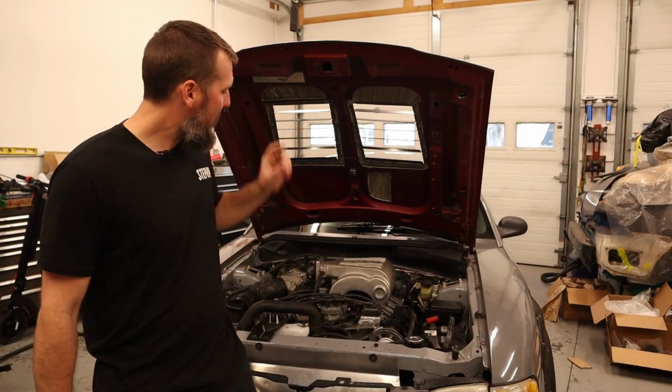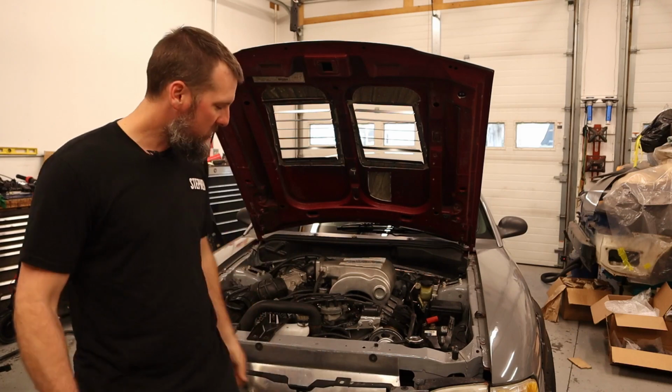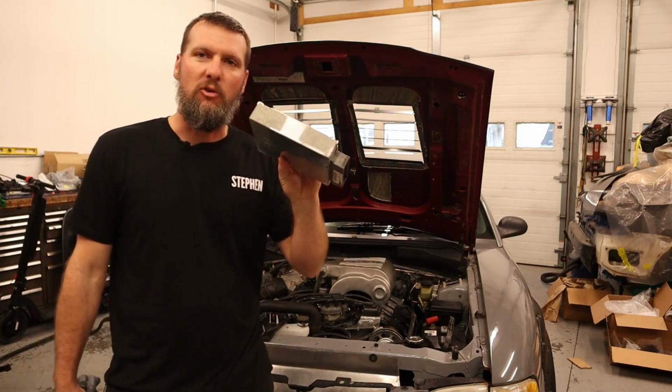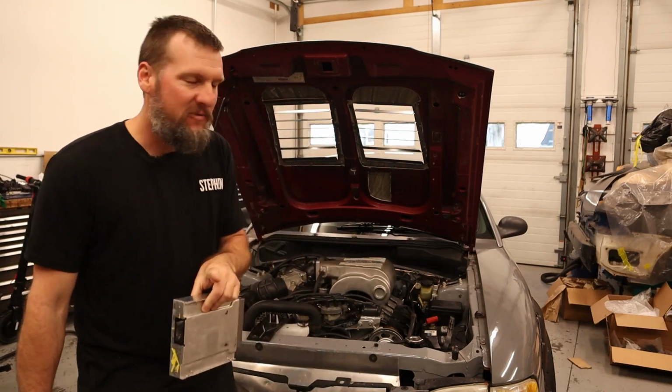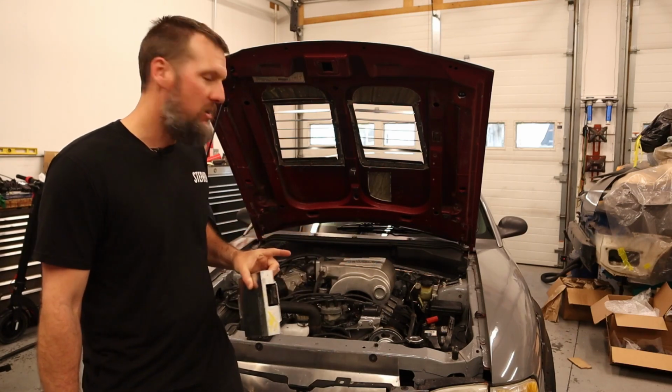In today's video, we are going to be getting rid of the distributor and the factory ECU. We're going to be replacing it with Godzilla coils and an ECU out of a Crown Vic. And hopefully by the end of this video, this engine is going to be running again on distributorless ignition. So let's get started.